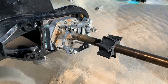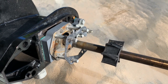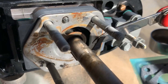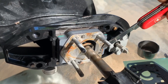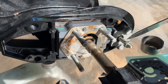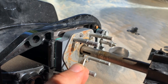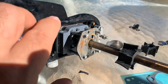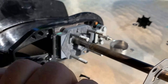You can see the broken impeller on the shaft here, and just across to the left we've got the gasket, which was completely broken with the left half on the bottom plate. I did have a new plate come with the repair kit - I thought about cleaning the old one up and saving it but decided to replace the whole lot. You can't put the new plate on wrong because of those two pins that go through the holes. I take everything off - the impeller and the base - and stick a new gasket on.